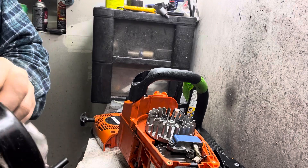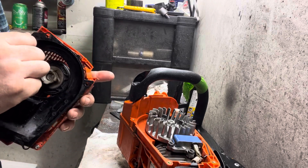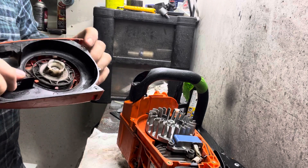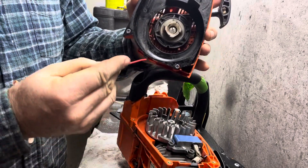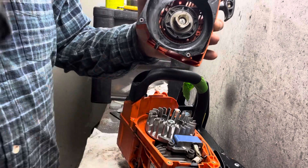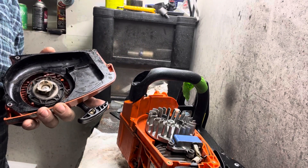So if you're ever putting one of these back together and you have that little o-ring sitting around and can't figure out where it went, now you know where that goes. As this goes in, that rubber o-ring sits right here and seals it so that it's not actually picking up fines from inside by the flywheel.